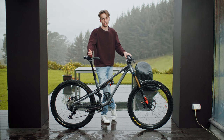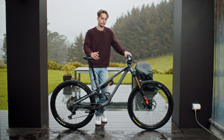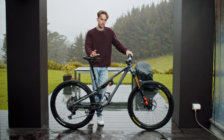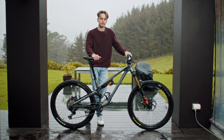Finn ordered himself and I a Title stem each, which is really cool. They look super nice. He got the black one, I got the chrome one just there. Super stoked with how the chrome one works with this bike. I was also really curious to try out the OneUp carbon handlebars, so I've got those paired onto the stem. I trialed a bit of bar width with the stock bars — they came 780, I cut them down to 770 and they felt quite a lot better. Being able to corner a bit better and move the bike easier in the air made quite a big difference. So once I got these bars, they came 800, I cut them down to 770 as well. Pretty happy with that — that's what I'll be running for probably quite a while.